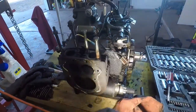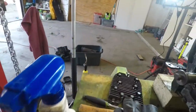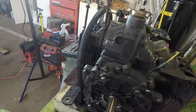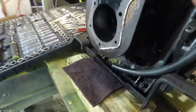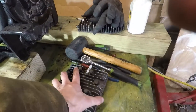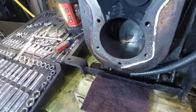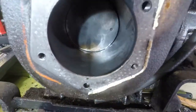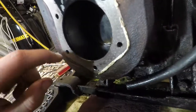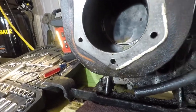Not sure if I'm going to keep tearing it apart today. Some of you used silicone on these head gaskets. The heads look okay — they're slightly scored and just have stains from sitting. The other side has some pretty bad pitting, so hopefully getting it bored out will fix that.